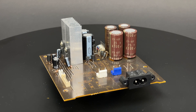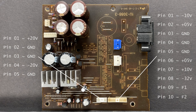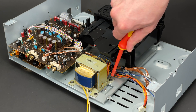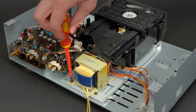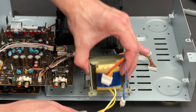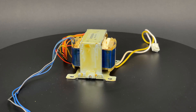This PCB provides a whole variety of different voltages to this unit. I will put a full pinout on the screen for you to have a more detailed look. Let's untangle all these wires and extract the transformer. As you can see, the CD mechanism and the transformer are fixed to this bracket, which adds more rigidness to this unit. That's the transformer extracted — it has one primary and four secondary windings.